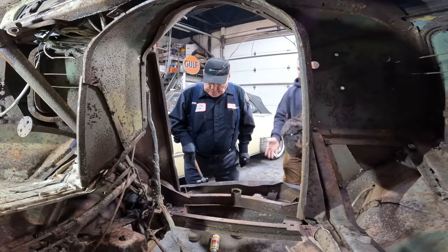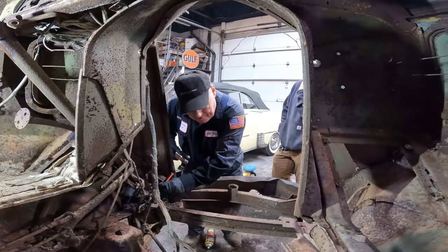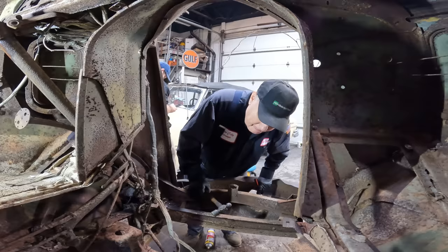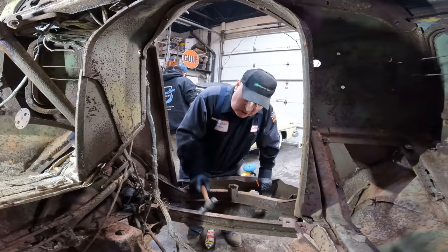The other thing, we're getting ready to leave the leaf springs as an entirety. So if there's a loose leaf spring, pull it out. I was picking up leaf springs off the deck of the trailer the whole way home, and it looks like that pack is almost completely gone on that side. Yeah, same thing with this side over here. It's all behind the wheels. So there's not much to do there, but just pull out any loose pieces. We could probably clamp that down, that would be good, with a U-clamp?